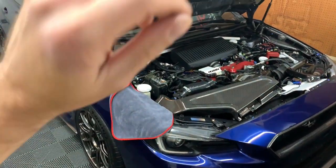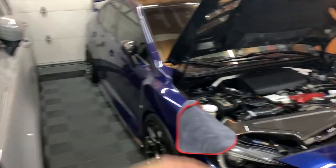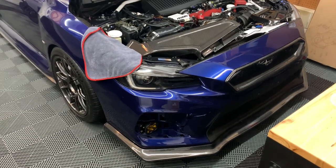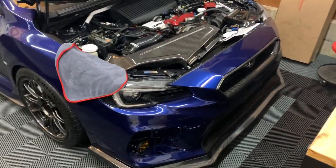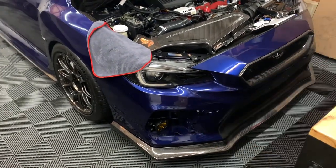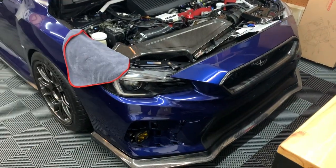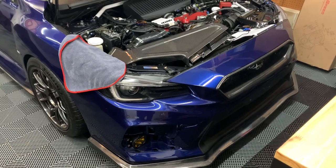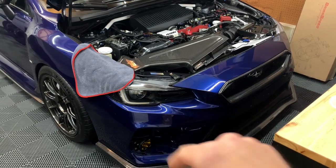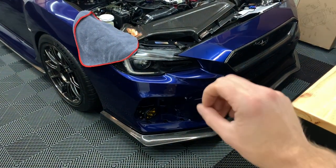After I installed the new headlights from Lightworks, I noticed that the C lights were not turning on as my daytime running lights. I can turn them on with the light switch stock normally, but all the lights would be on — so my taillights and everything — they weren't turning on as my daytime running lights, just the strip lights down here. So I got to thinking I'll just tap into the wire harness for the strip light down here, and I'll have daytime running lights as the strip lights as well as the C lights. So I tapped into the daytime running light strip harness for my C lights.